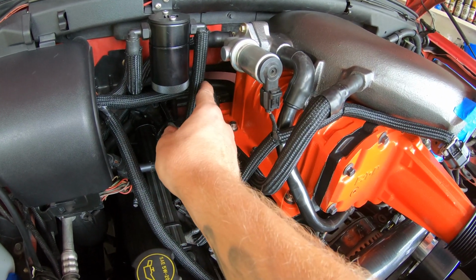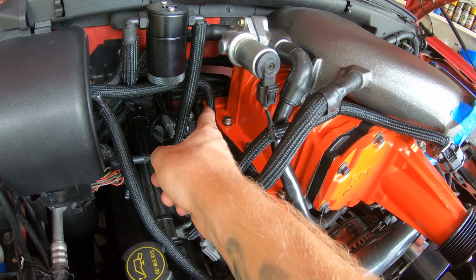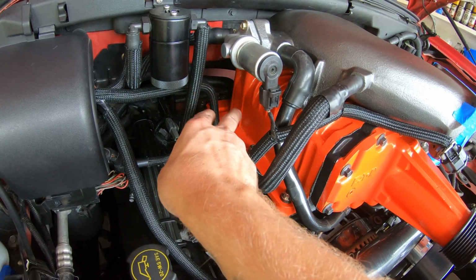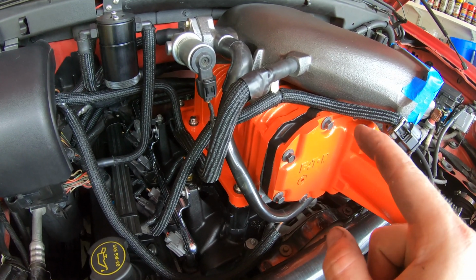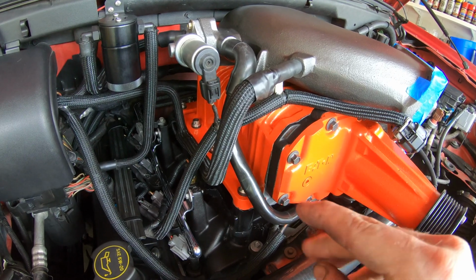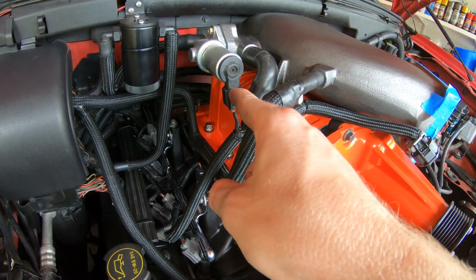Torque those bolts back there first, because once you get the blower on, you won't be able to access them real well, so I suggest doing the intercooler ones first, the ones in the 4 in the back, and then attach the hoses as well, then put the blower on. We learned that the hard way because we didn't do that. We put everything together, tightened it by hand, let the RTV do its thing for like 30 minutes, and went ahead and snugged them up, and it was a real pain in the ass to get back there.